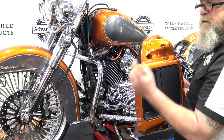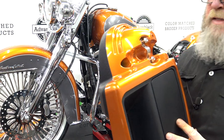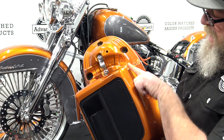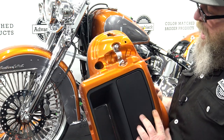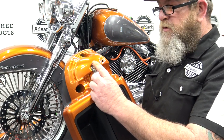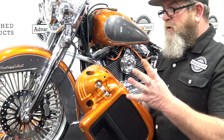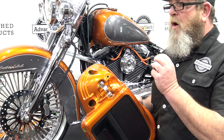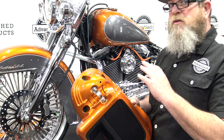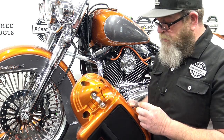The other one's going to have the vent on the inside going to the other side. On the back side here at the top, you can see where the crash bar comes over and curves down — the crash bar will run right through the slot. You have a clamp right here with two nuts. You're just going to simply remove the two nuts. Now, with all the different crash bars on the market, they're all labeled the exact same size, but aftermarket crash bars tend to run a little bit smaller than your OEM bars.